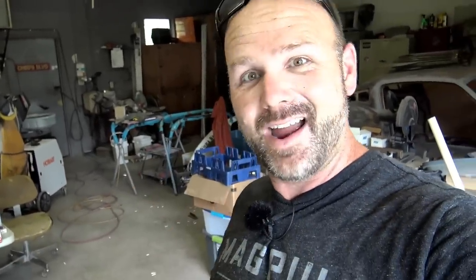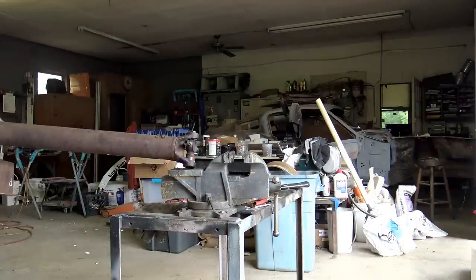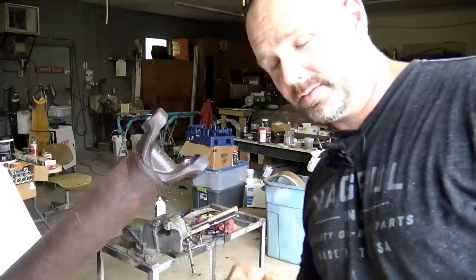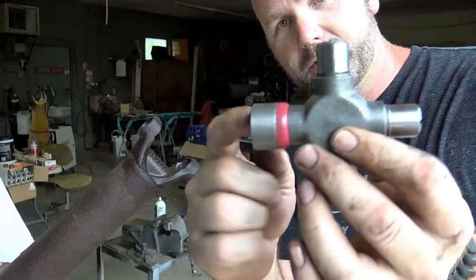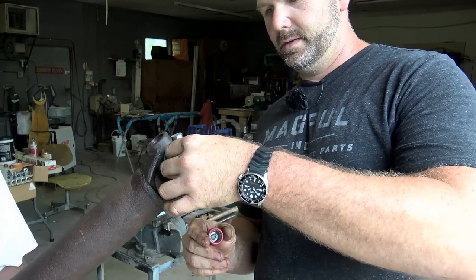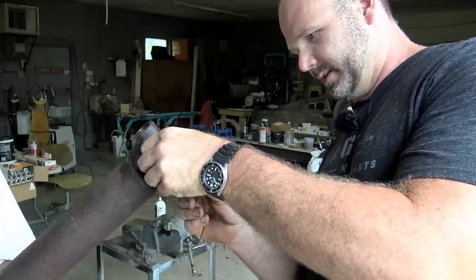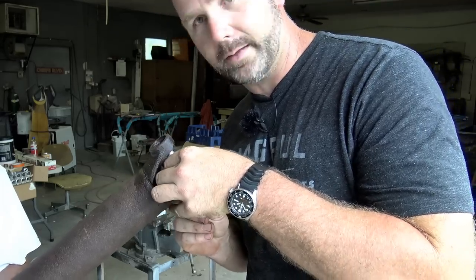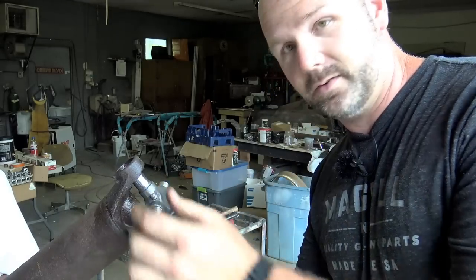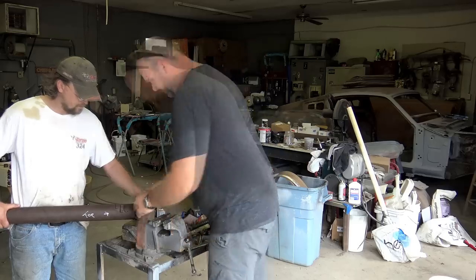The sucker just dropped right out of there. It is hot and humid — it is rough. But now you know how to take one out. Randy is earning himself a Stony Ridge Farmer t-shirt today. So what we're doing right now is we removed three of these cups, and we're going to remove one more cup here and insert it into this end. Basically take this U-joint, insert it in, then take your cup and insert it as straight as you possibly can. Make sure you don't lose any of those little needle bearings, because if you do, you'll be pulling this thing out and doing it again.